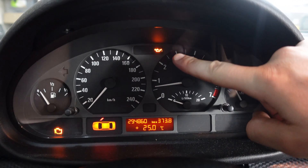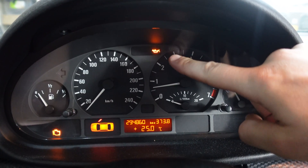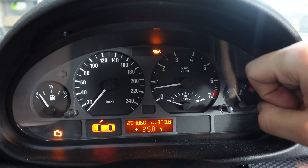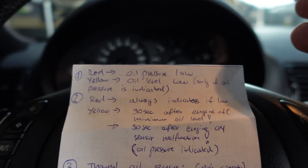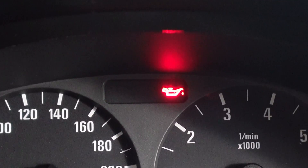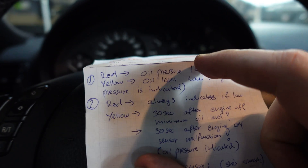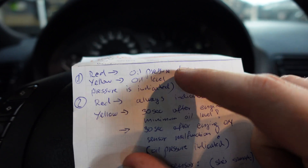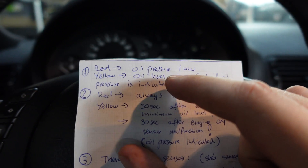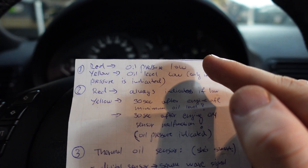And here it is. It goes on a couple of seconds after you start the engine and then it shuts off. The red warning light for oil means oil pressure — if it turns on it means that the oil pressure is not present. These engines only have an on/off sensor like a switch, so you don't get an actual reading of the pressure; you just get pressure on or pressure off.